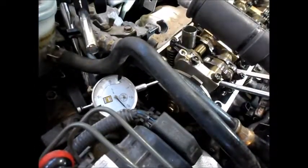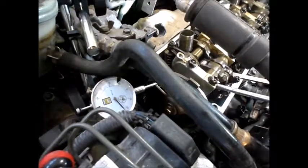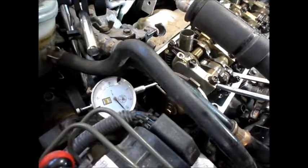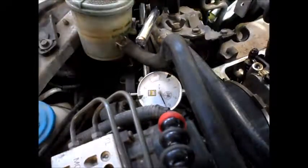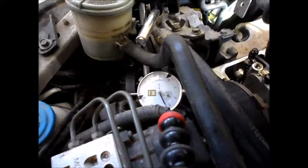Anyhow, if you do that, here's the dial. I'll put it so you can see the dial indicator, with this thing in the way. Well, maybe not. How about over here? There. Now I take my screwdrivers and pry the camshaft one way and then the other way.